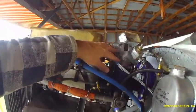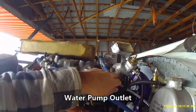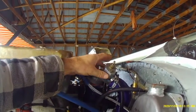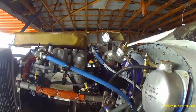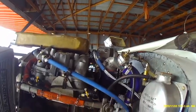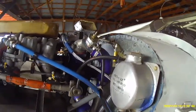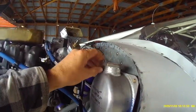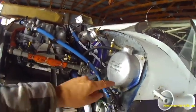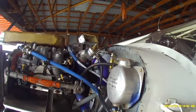On this side of the engine you can see the outlet to the water jacket system — it's been modified and welded. This is an adapter I made. This hose is to return air — it's the highest point in the system — mostly to get air out, and it goes into the bottom of this catch can, a secondary fill point. This is the pressure cap for my system. I typically keep it about half full — about two and a half inches of 50/50 coolant, glycol and water.